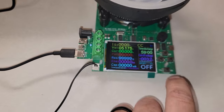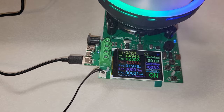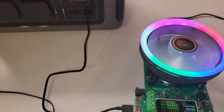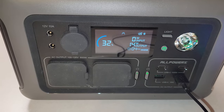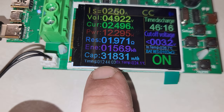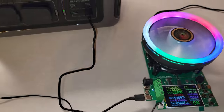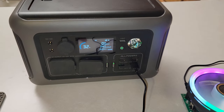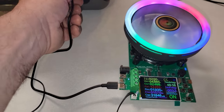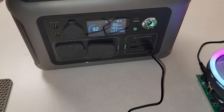Whether using USB-A or USB-C, it really doesn't matter — the battery capacity is what we're really looking at here. This thing charged an iPad Pro and a MacBook Pro just fine, just like a plug-in charger. So we're at a 2.5 amp rate. We've been running right at 14 watts. We've been running almost 13 hours — 12 hours and 44 minutes. At 2.5 amp load, we're still running 4.9 volts. So if you were charging multiple phones all day for 12 hours, you'd still have 32% battery life left.